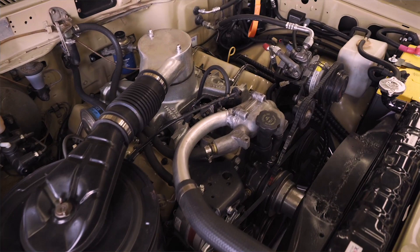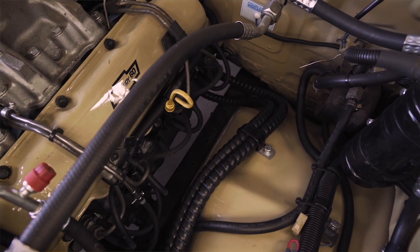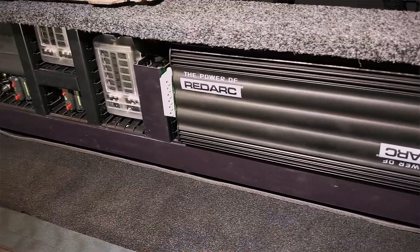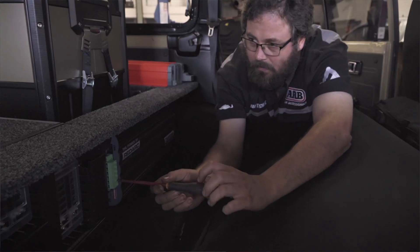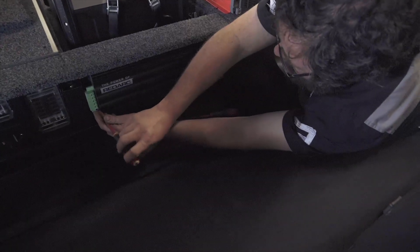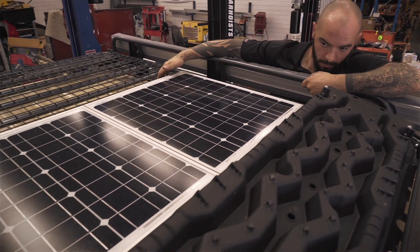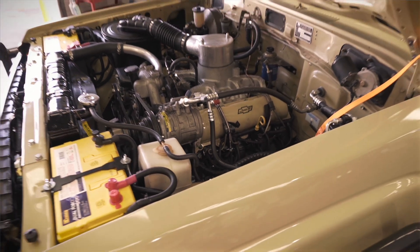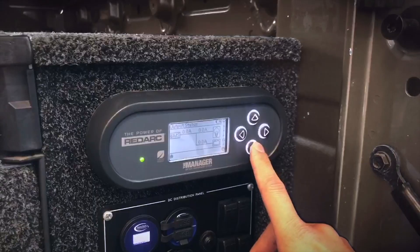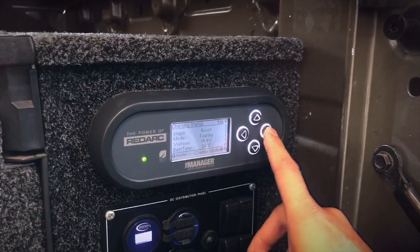For the Chev V8, to take it to the next level, we've actually custom rebuilt the wiring loom. The battery management system in this vehicle is a Redarc Battery Manager 30, which gives us 30 amps of input. We can take power from 240V mains, solar off the roof — in this case two 50-watt solar panels — and we also get 12-volt charge from the alternator up front. There's a display mounted on the back of the drawers which provides all the information on where our charge is coming from and how much power we've got left.